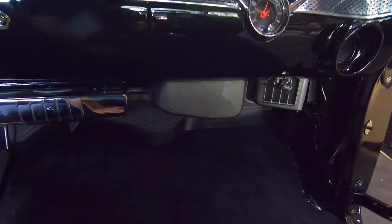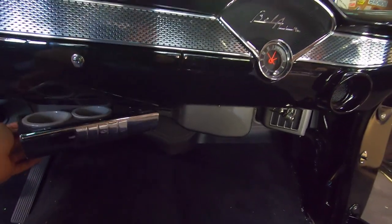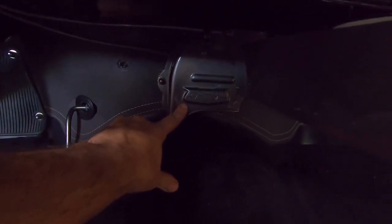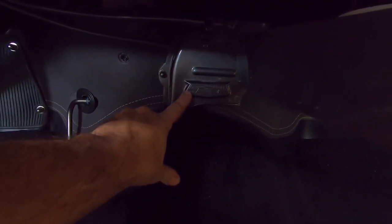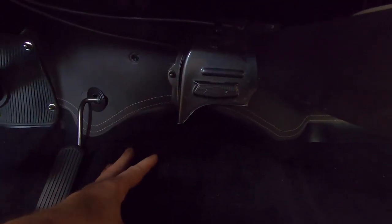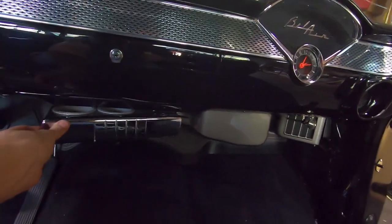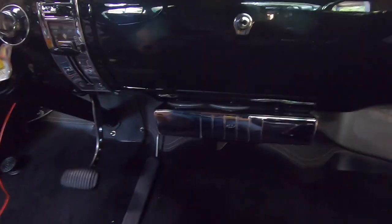I have my original heater box in here — this is actually a deluxe heater. You could get a standard or deluxe; this is the deluxe. I took it all apart, smoothed it all up with body filler, and repainted everything. I took a quarter panel crest — an original, supposed to be gold anodized — it was all faded out, so I panel-bonded it on there and edged it in so it looks like it's embossed in the steel. But since I put my cup holder assembly in here, you don't really see it anyway.